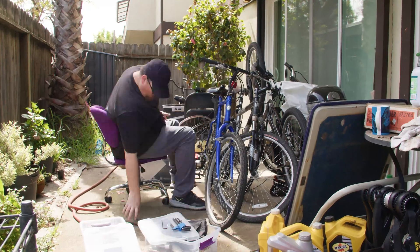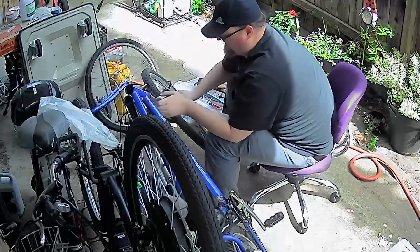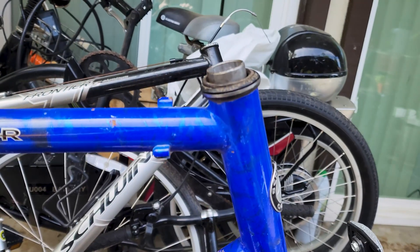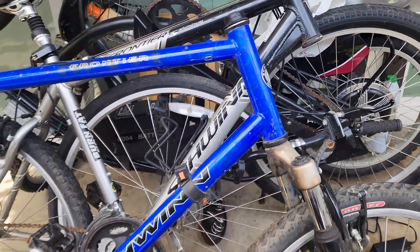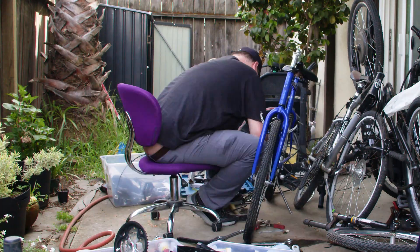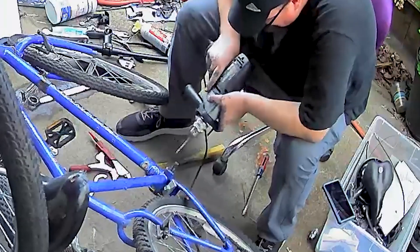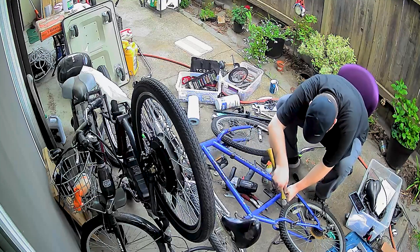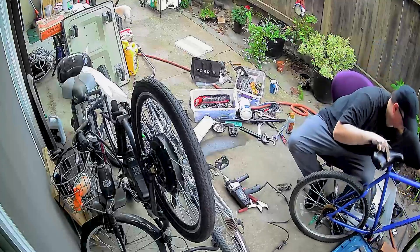Next day I'm off to the races. I unload all my tools and start tearing apart the front forks of the blue Schwinn. I get them off fairly easily, but when I get the other Schwinn forks with shock absorbers from the other bike on, they're too short. I have to put the original forks back on and risk it with those standoffs — this is just too short and that sucks. Next I try to pull off the crank to get to the bottom bracket, but the bottom bracket seems to be frozen on. I'm trying everything to get it off, but it's not budging, and I can't pedal a bike with bad bearings. I go ahead and throw this bike off to the side — it's time to try another bike.